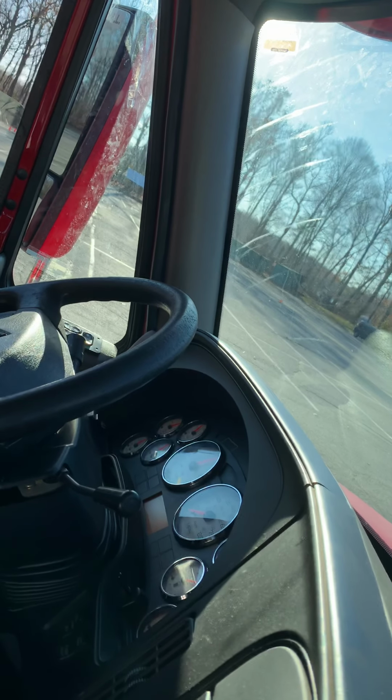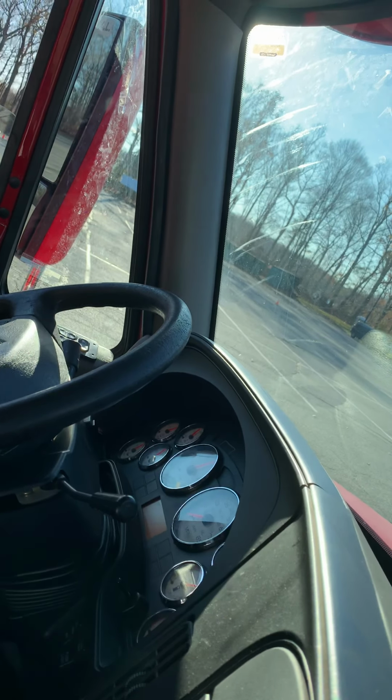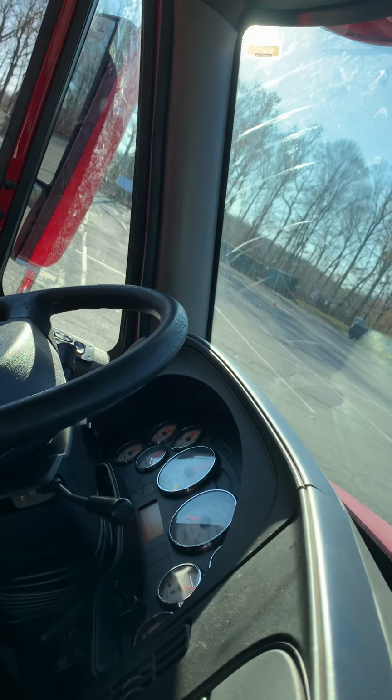Just this much, right? To summarize, when air pressure reaches 120, the air compressor stops working, the governor valve cuts off. Okay, we all hear a sneeze come from outside. Okay, the air pressure falls. So I will turn off the engine.